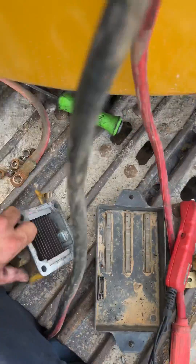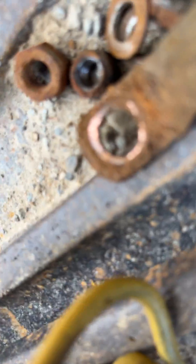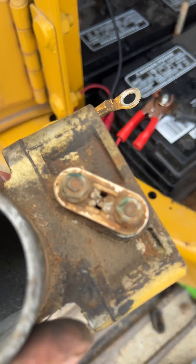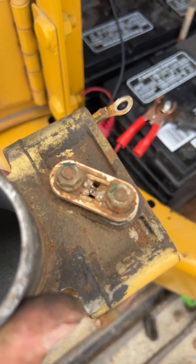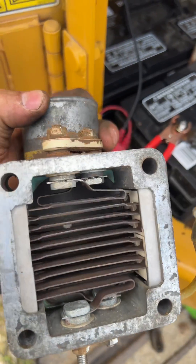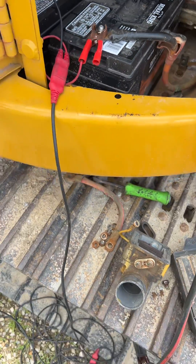At the bottom of this unit there's like a little inline fuse, and that guy right there is blown. So I'll probably just want to get the grid heater and then also get that updated harness — just in case. Hopefully it'll help you out.